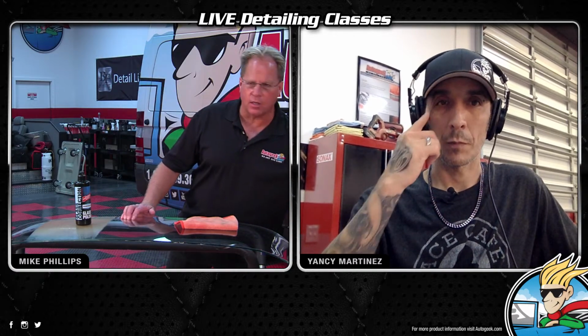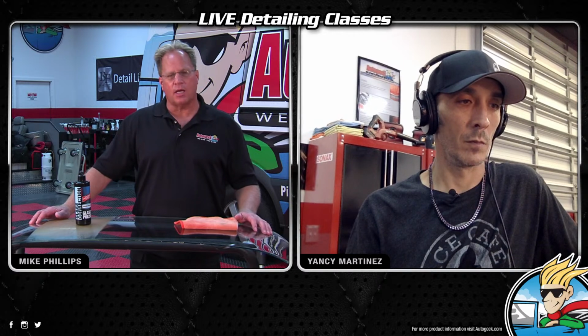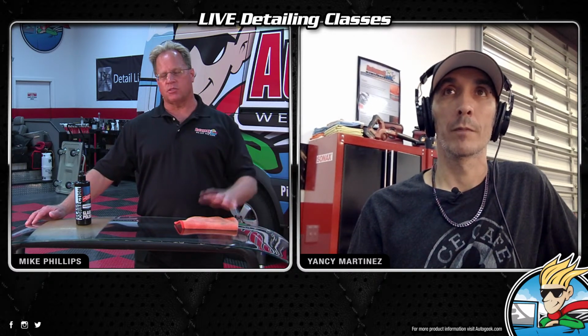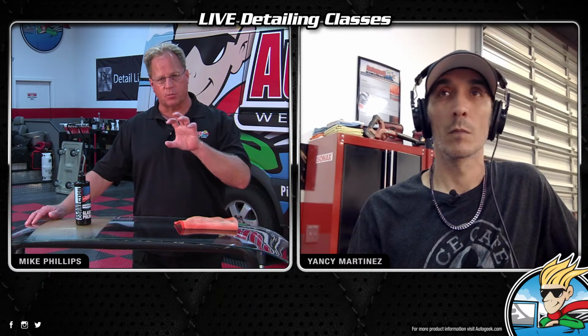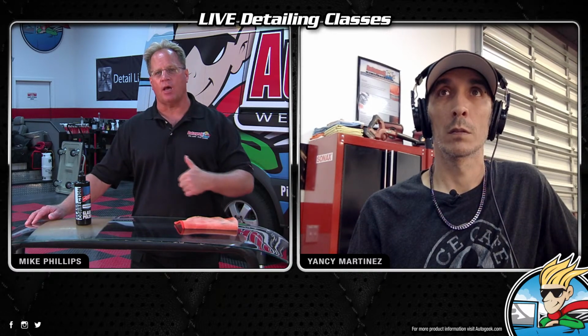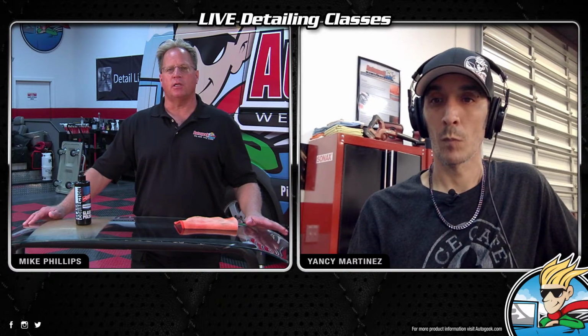I met a guy recently on the Autogeek forum that tried everything I did. Luckily for him, he tried it on a side glass and he got some micro marring. I told him the same thing. I said, something was wrong with your process. Something was dirty. So he cleaned everything, ordered 2 fresh glass pads, redid it, and pulled everything out. So that's why you need to work clean, surgically clean.